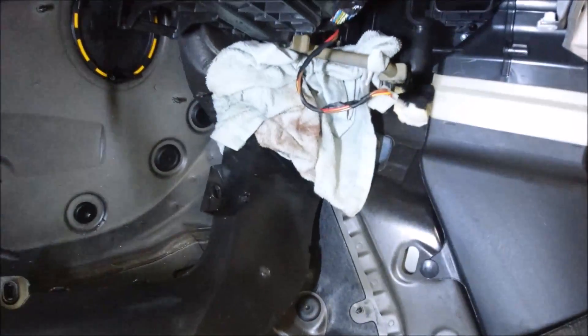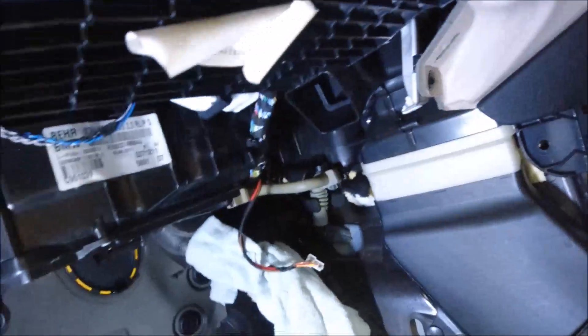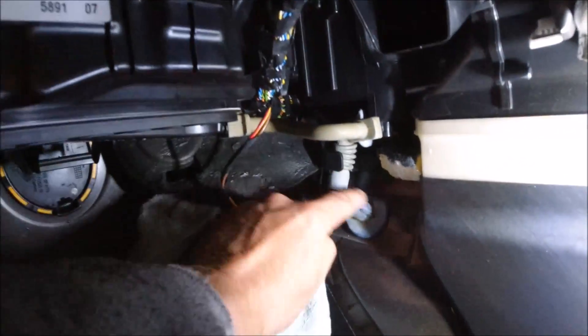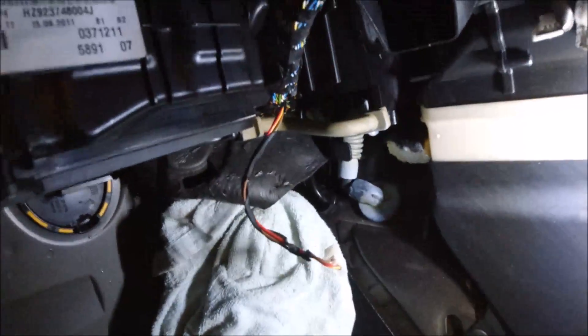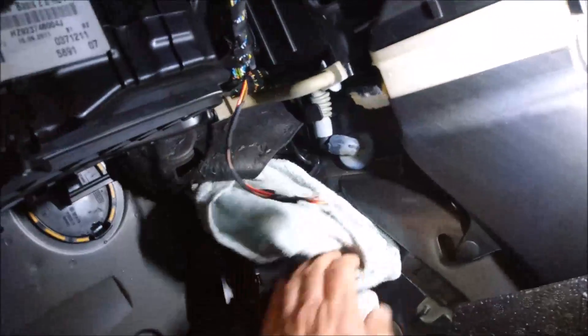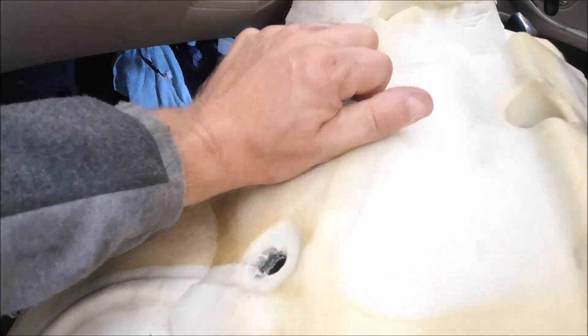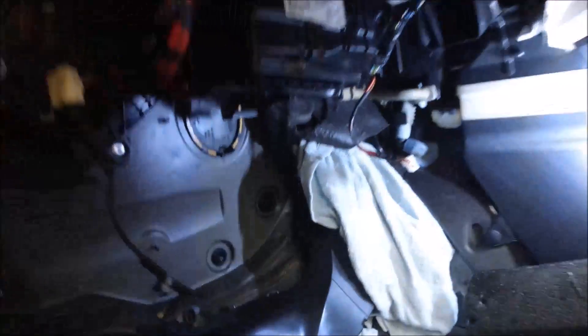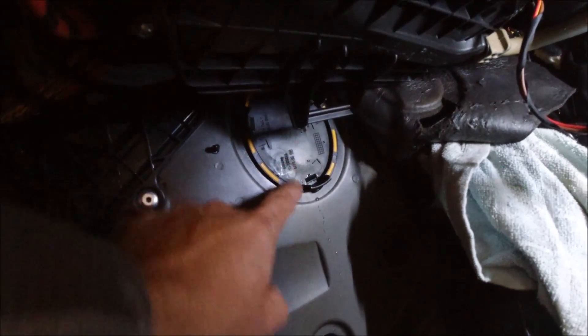The first thing I think is probably we have a leak from the air-conditioned pipes, from this pipe or this pipe. But if you check here, there is no water - it's all fitted like it should be. So the next step is looking for the highest point that's wet. This area is very wet, and the highest point was actually this seal.